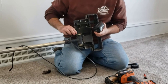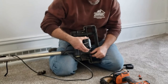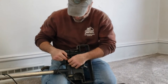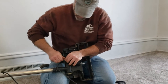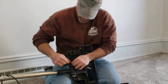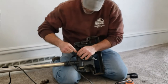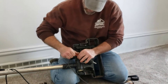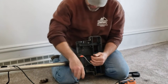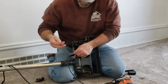There's a black and white coming from the back of the sweeper head, and a black and white coming out of the new motor. We're going to hook those up right now — I've got two wire nuts. White to white, black to black. As long as the color code matches, we should be good. Make sure they're nice and tight — give the wire nut a pull to confirm it's biting properly.